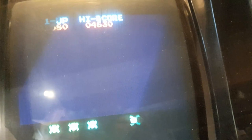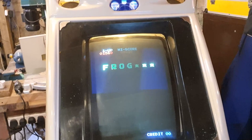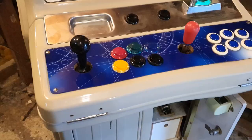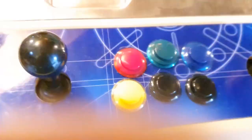Let's get on with the cleaning — I'm going to have to pop this glass out. I've tried to sharpen the monitor; I think it's okay but the blue probably needs better adjusting. I just need to degauss it for now and deal with that afterwards. I don't have a degaussing wand; I might have to make one from scratch. You can actually use a coil from an old monitor and a light bulb to make a custom degaussing coil.